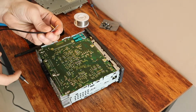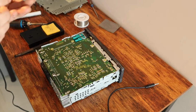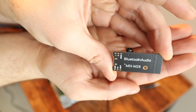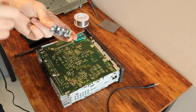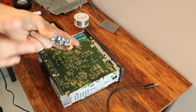These cords have right channel, left channel, and speaker ground, which then conveniently goes to mini jack plug. Now mini jack is what is going to plug into your Bluetooth board. The Bluetooth board that I'm using is the EM1. So when I did this mod on my CL CD player, I tested a whole bunch of these different Bluetooth boards, and this one by far sounds the best for this type of application at least. So I recommend using this Bluetooth board, and again, this will be linked in the description.